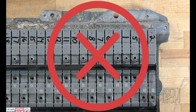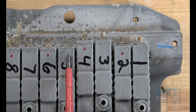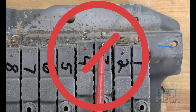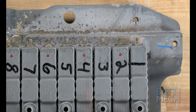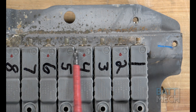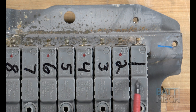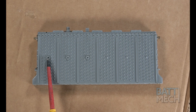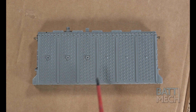Try not to make mistakes like this or your pack will fail. As we zoom in, notice how the modules are misaligned — this is not correct. Modules should be flush and aligned as you see here. This is achieved by making sure these interlocking tabs on the modules line up to where they connect with another module.